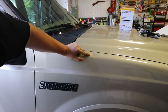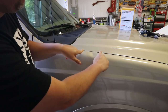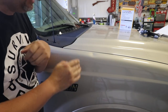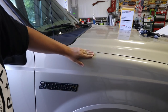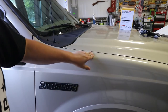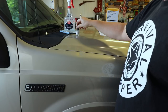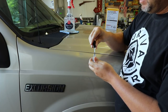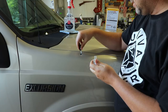I'm nicknaming this dent 'Godzilla' because it is a big old boy, right here on the top of this fender. I'm going to put the two feet of that dent puller right there and pull it out. It didn't distort the fender inward — it just pushed it right there and I think I can get it out. First I'm going to put some paint prep on it, clean it up, get the oils off, and then we'll try gluing it. I've already cleaned it with Griot's paint prep once to get the grime off.